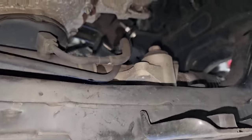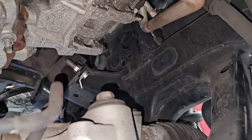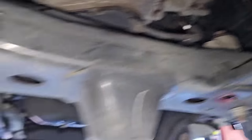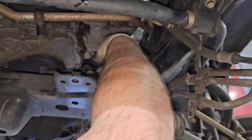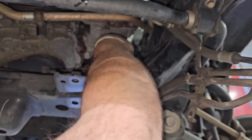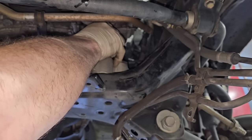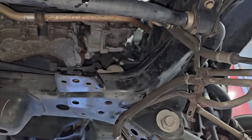With the lines out of the way I have plenty of room up here. However, one thing with curiosity here — I was wondering why they told you to take the AC compressor out, because I don't think there's enough room to get that bolt out. Well, we're going to manipulate this and see what we can do to try to fudge that and not have to take the compressor out. Let me get these off — these look to be 17s. So of course the bolt won't clear. However, I think I can manipulate this rack around in a way to make it so I can get some clearance. There we go, that's it — bolt's out.